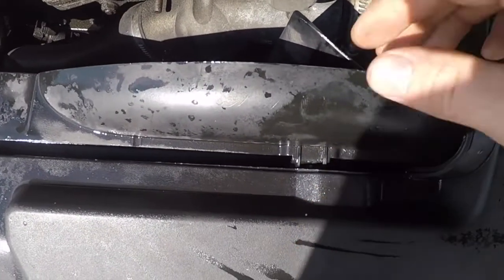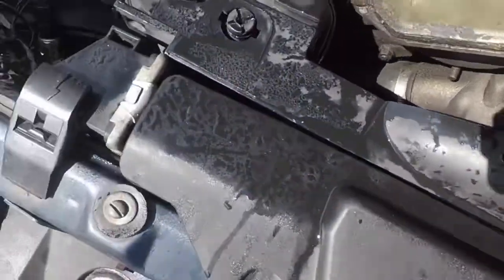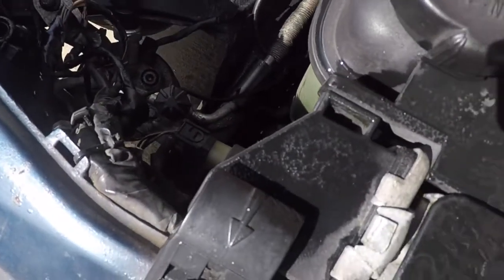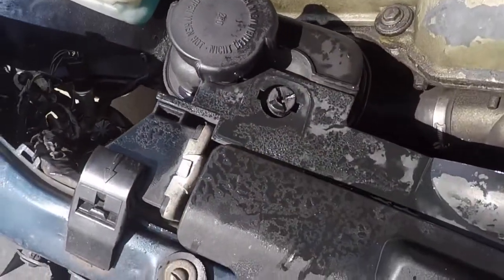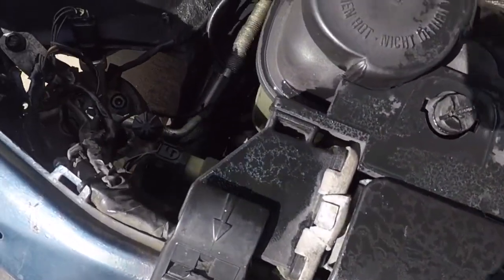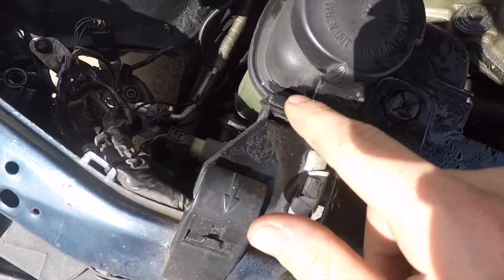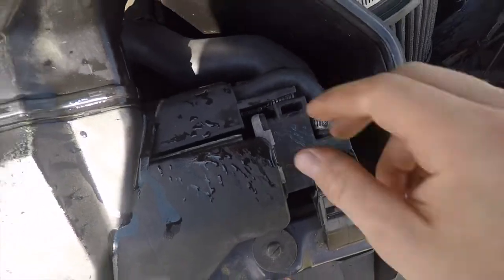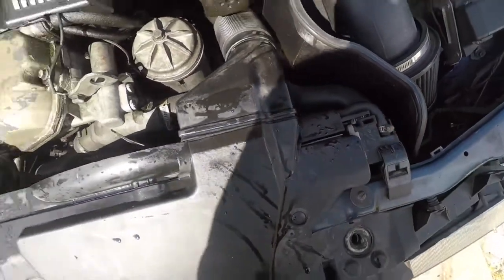The fix is going to be a new radiator obviously, but I popped this back into place. What I have on my white E36 is probably what I'm going to do here — people call it cheap — but I think it works best. These clips become very brittle, so I usually zip tie the fan shroud into place on both sides. From there they don't break off and the fan shroud doesn't even move or budge.